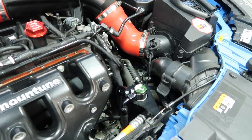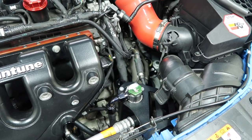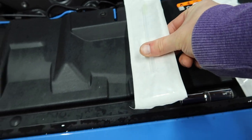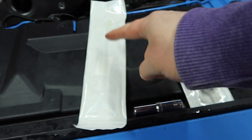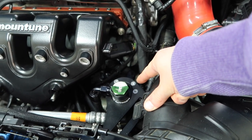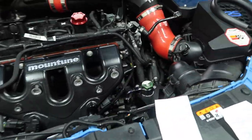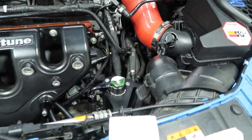There is another solution which I'm going to try right now using a couple of very cheaply available items. What I have here is a basic 20ml syringe and a mixing quill — essentially a tube that connects onto the bottom of the syringe. I'm going to place that down into the catch can via the dipstick hole, which is fairly unique to the Radium system, and then I should be able to syringe out the oil without having to do anything awkward or source the petcock.